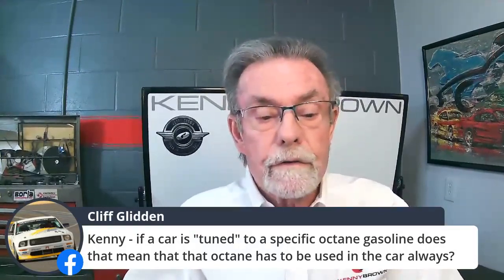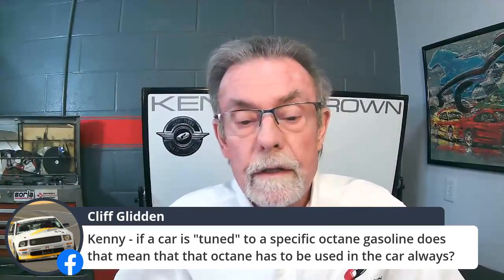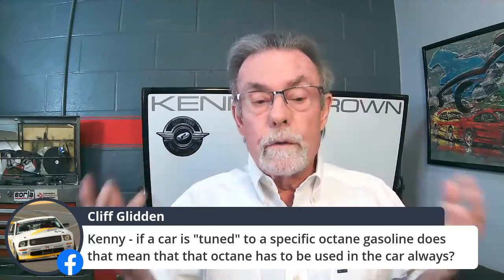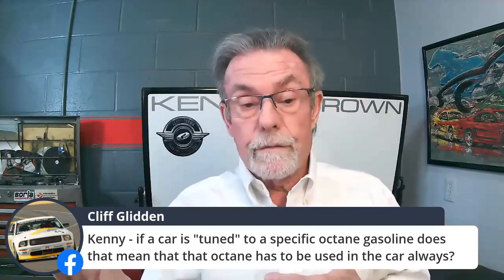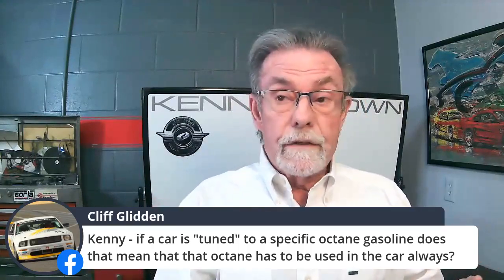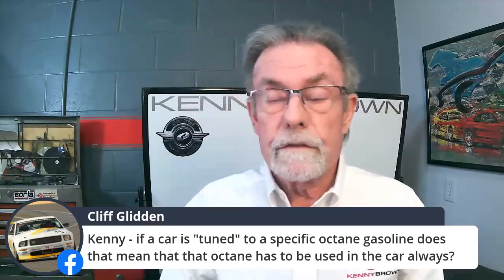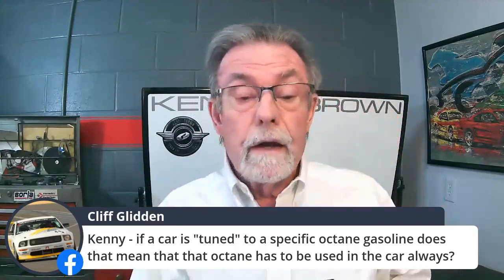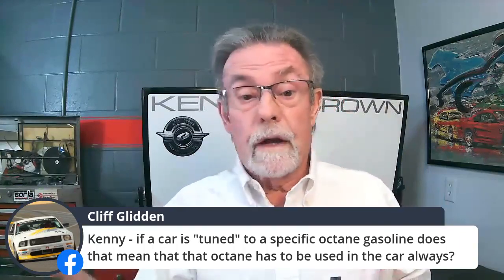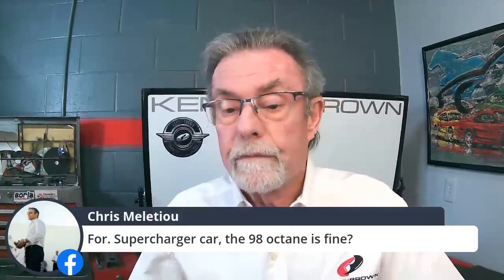Cliff says the car is tuned to a specific octane of gas. Does that mean that octane has to be used in the car? Oh yes, either that or higher. If it's tuned to 93, and out here it's 93, I think in the West it's 91, and you put in 87, there's a really good chance it's going to be too much timing and you're going to pick up pre-detonation. Once the car is tuned to a specific octane, you can go higher, but never lower. If it's tuned to 91 octane and you can get 93 or 94, no problem. Going up doesn't hurt, going down does.